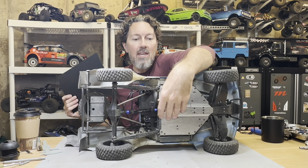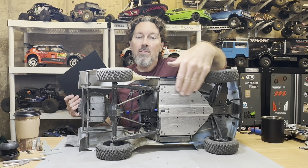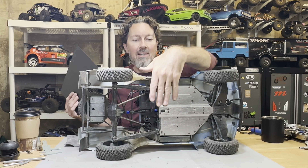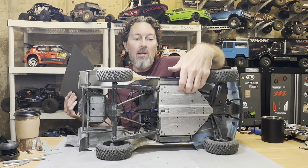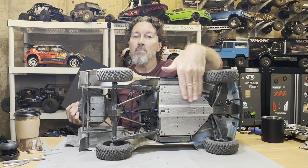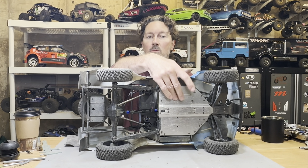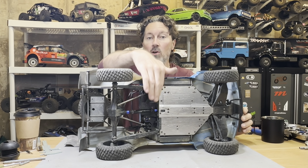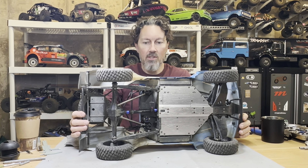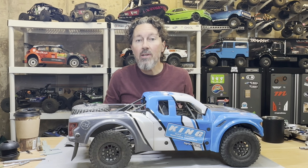I'm going to cut out a rough shape, heat it up, mold it to the lower bump-out section on the bottom of the chassis, mark some screw holes, and hopefully it works out. Because this is kind of a slippery plastic, when you bottom out going over rocks it should help the truck slide over a little bit easier. My main goal is to mount the flap by sandwiching it along the back section and running a couple screws through it.